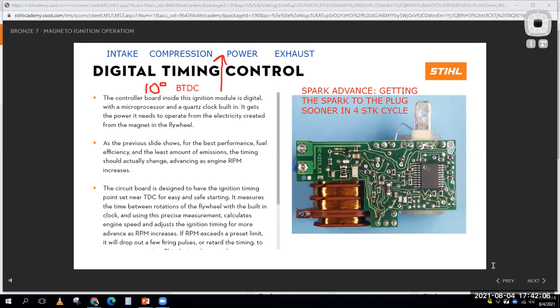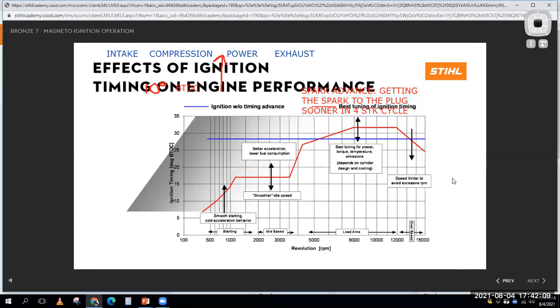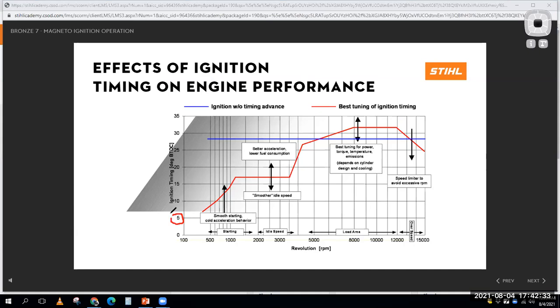So now if I go back to the previous slide and get rid of my crazy drawings, what this image is showing us is that at higher speeds on the high-end products with better designed ignition systems, they actually give us a variable advance curve where we start off with a low amount of advance. Here's my degrees of advance, so I'm at degrees before top dead center. So here I get it started at, I don't know, 10, 12 degrees before top dead center. That gets me up to about 18 degrees before top dead center for the variety of my running,